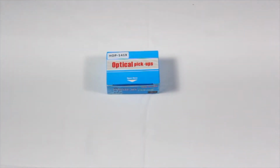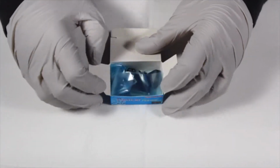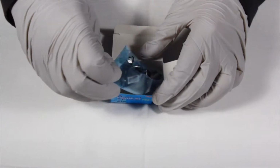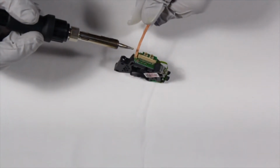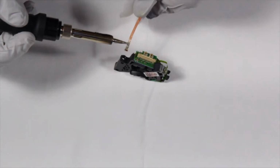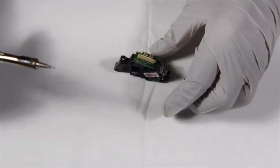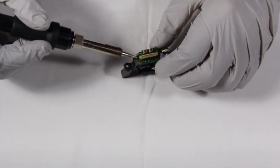With the old laser out, it's time to shift our focus to the fresh one, so pop that box open like it's a Christmas present as we prep this one for insertion into the console. You'll need to heat up the ye old soldering iron for this one, as we're going to have to remove an anti-static solder ball bridging 2 points on the laser's PCB. Once the solder has been removed, the laser should be ready to install into the drive.